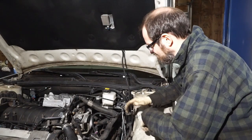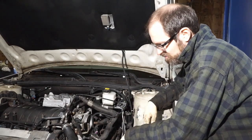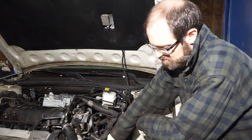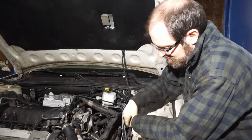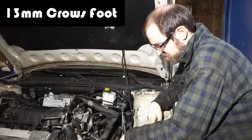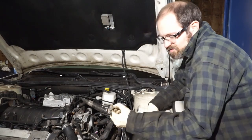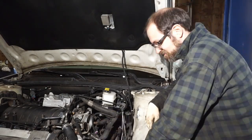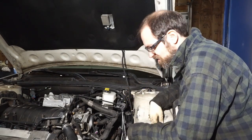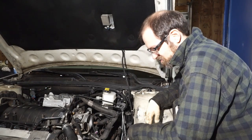Once we've gotten all the brake fluid out of this thing and all various lines, we're going to disconnect the master cylinder lines from the ABS pump down here. This is a 13mm — I always use a crow's foot for these because that's just the easiest thing you can do, since the flare nut wrench is just not going to fit in there. Hopefully it will come loose and I can just hand-untighten it for most of the way, but this could be a long and painful process.